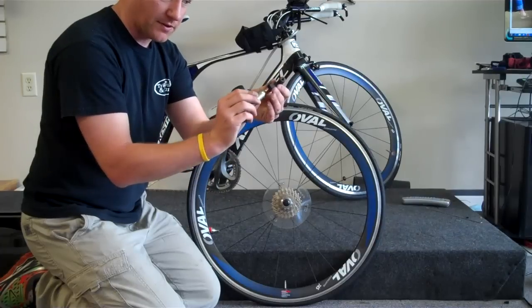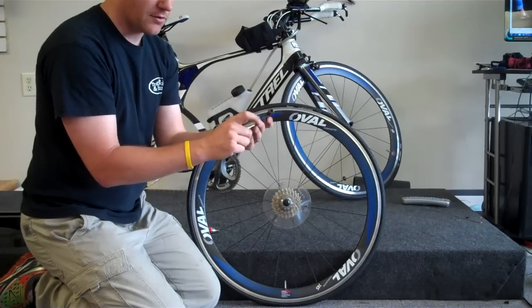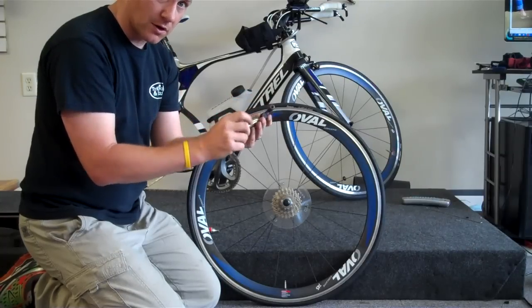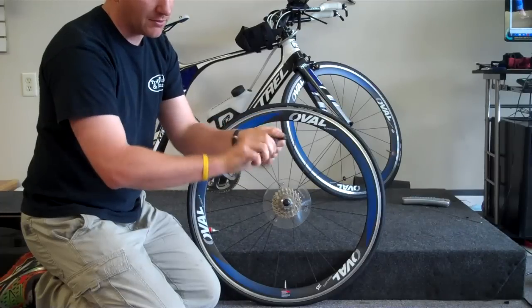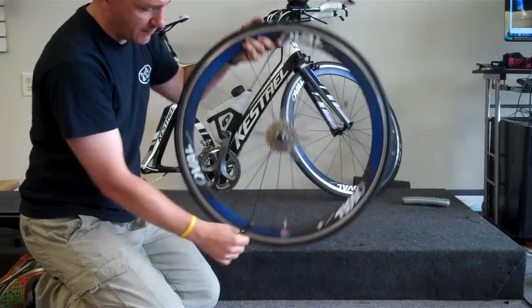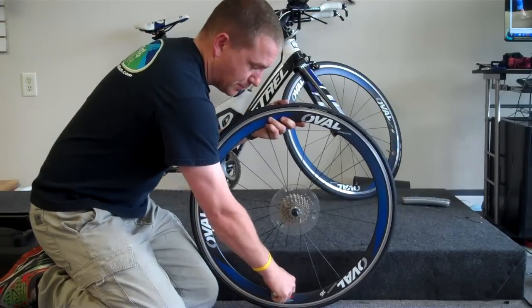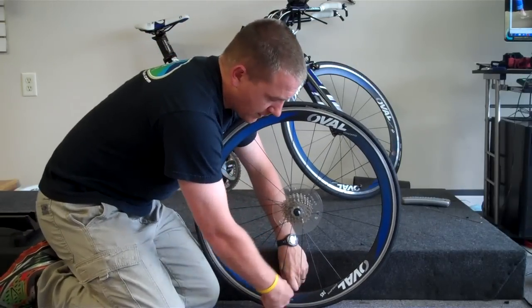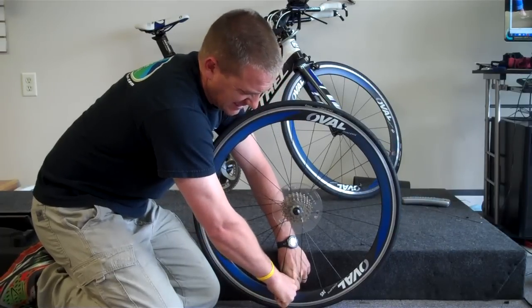With this particular one, this is a screw-on, and then I back off in order to get it to engage. There are also spring-loaded heads, and there are trigger cartridges that go on here. So I'm going to take this and screw it on really, really tight. I've taken my valve stem and put it down at the very bottom. What I'm going to do is push this head on there, hold on to the tire, and back off just a little bit my CO2 cartridge.